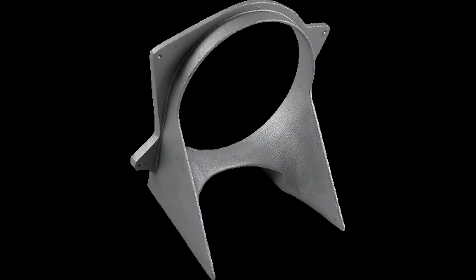What I wish I would have done, which I actually didn't, I'm going to be doing on my next build, is to put on the pump shoe at this point with the inside of the hull open and put bolts on the other side of it, and then put 5200 over those bolts so that no water can enter through the pump shoe screw holes.